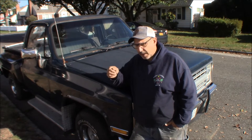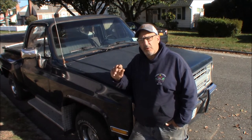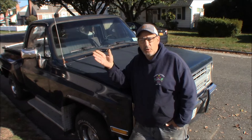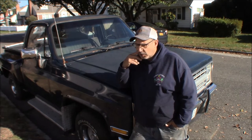What I did was turn that key on a quiet morning to see if I heard the two-second prime. On these old TBI GM vehicles, when you turn the key on after it's been off for 10 seconds or more, you should get a two-second prime - the fuel pump turns on for two seconds. If you have a quiet pump it's sometimes a little challenging to hear, so using two people is best: one by the tank and one by the ignition. I was not getting my two-second prime.